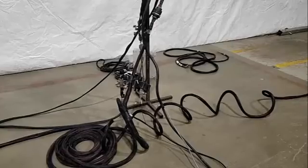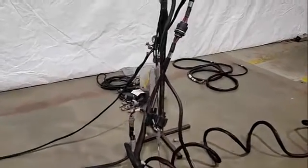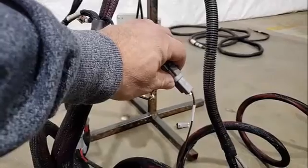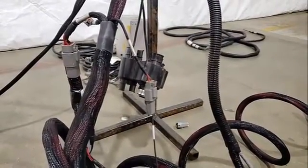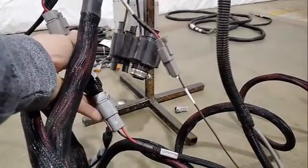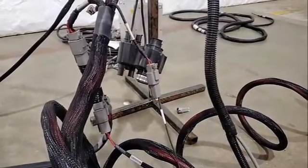At our T in the harness where we have the breakout wires and the ECU breakout, the whisker switch here can be tied in to run the lift-lower. When lift-lower is tied in, we also will have a power wire getting power to power the whisker switch for the lift-lower.